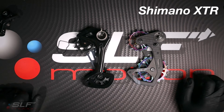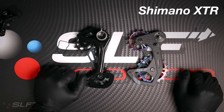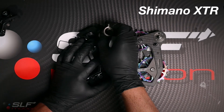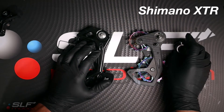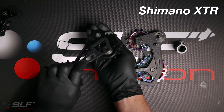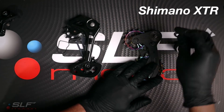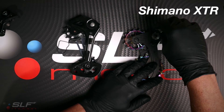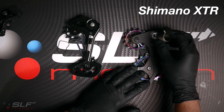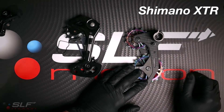With the stock cage removed, we are now ready to prep your EVO system. We will use the stock spring and stock plastic dust cover, as well as the silver metal washer. This washer is critical — make sure you use it. If you don't, your system will bind and it's not going to work. Install that first and slide the spring and dust cover on.